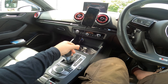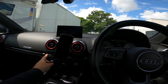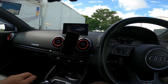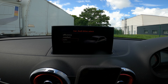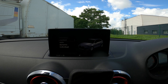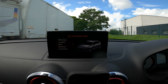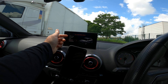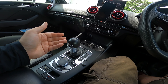I'll go through the modes quickly. Efficiency mode is basically going to use engine cut-off a lot — every time you let off the throttle it will disengage the clutch to maximize efficiency, and you won't have any pops and bangs. Comfort, auto, dynamic, and individual are all pretty much the same. The main differences come down to three modes — efficiency, dynamic, and sport — when it comes to rev behaviour and feel.